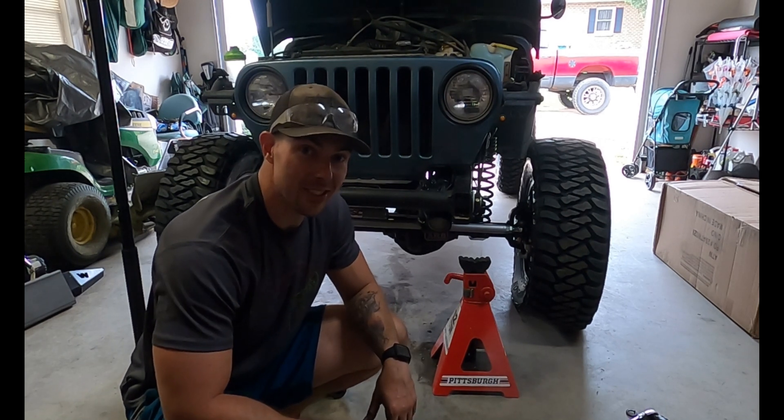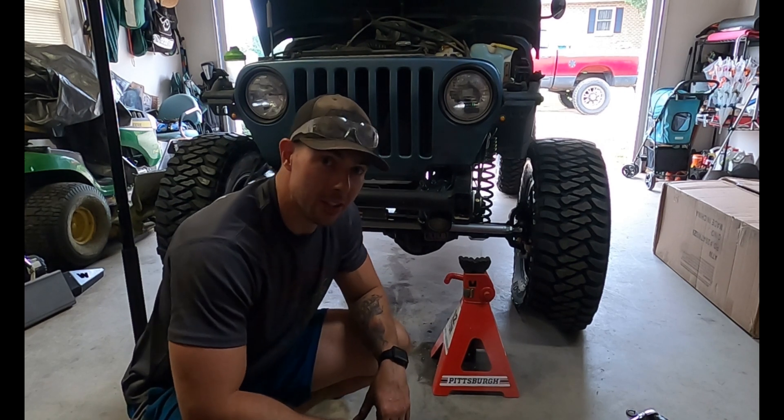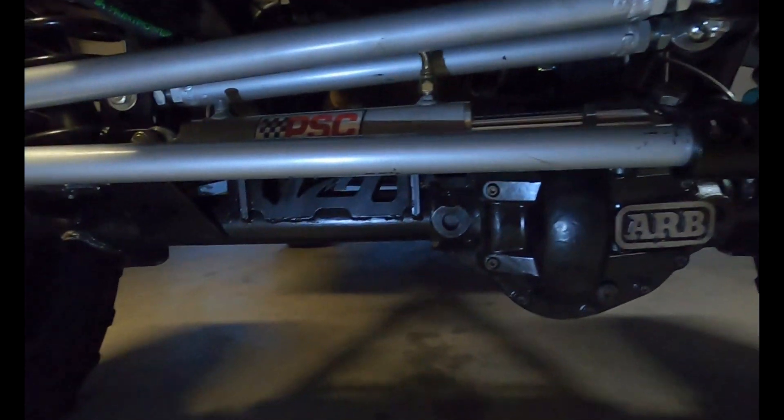There it is underneath its own weight for the first time in about five weeks. We got some fine tweaking to do, some things to make, but overall I'm really excited about the way it looks. We just finished up the double shear pitman arm, finished up fixing the knuckle, finished up with the hydro assist — all our custom parts are on there. Everything is nice and tucked beautifully, double shear pitman arm, everything double sheared. It turned out great, I couldn't be more happy.